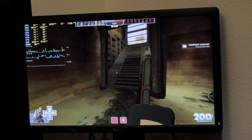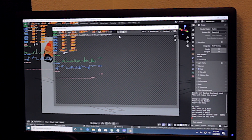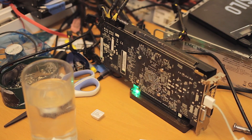Let's try Blender. Running the standard BMW test bench, CPU-wise it ends up about where Core 2 Duos are, which explains a lot of the performance — this is roughly on par with a Core 2 Duo, arguably even worse because this has more threads and a lot of programs like single-threaded performance. The onboard GPU is arguably better, but that doesn't matter because we have a nice external graphics card. That nice graphics card never really gets to stretch its wings because the CPU won't let it do anything. Even in applications like load screens, it ends up really hurting you.